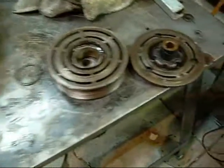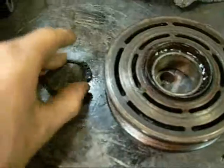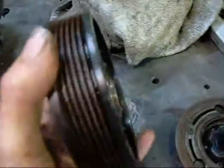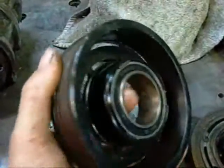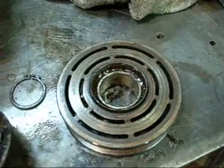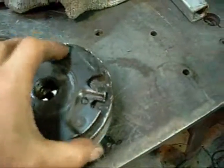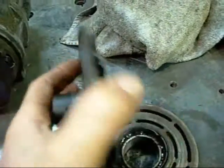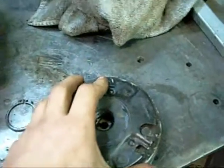So far I've got the main drive plate and pulley off. That's held on with a circlip and a retaining nut on the shaft. This is the serpentine pulley with an idler bearing - pretty shagged. These are just steel-on-steel pressure plates, there's no material on it like a brake pad or anything. Once this electromagnet is energised, it's basically magnetised with this pulley, which then attracts this clutch plate which has little leaf springs in there, independent of the centre. It pulls it into contact and provides enough drive for the compressor to do its thing.